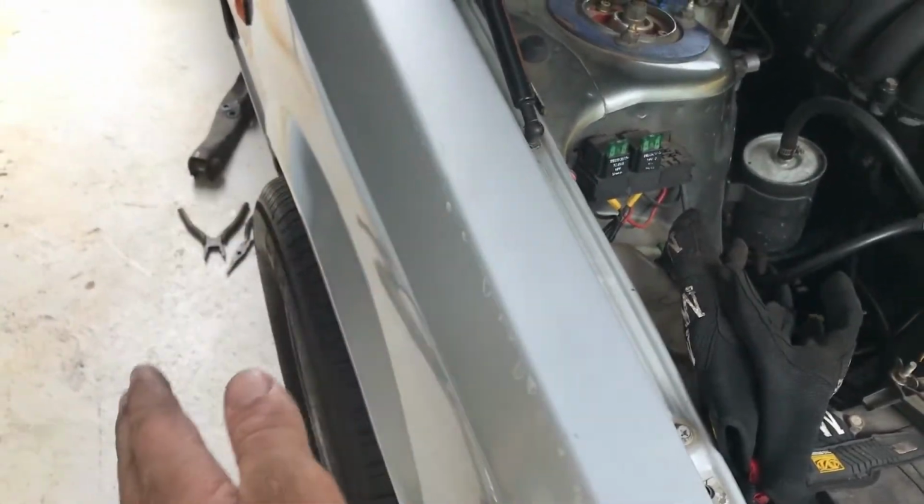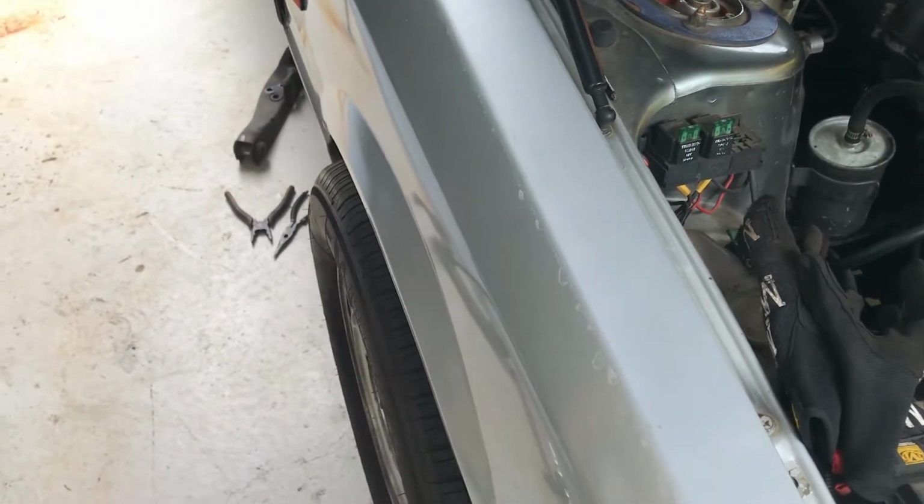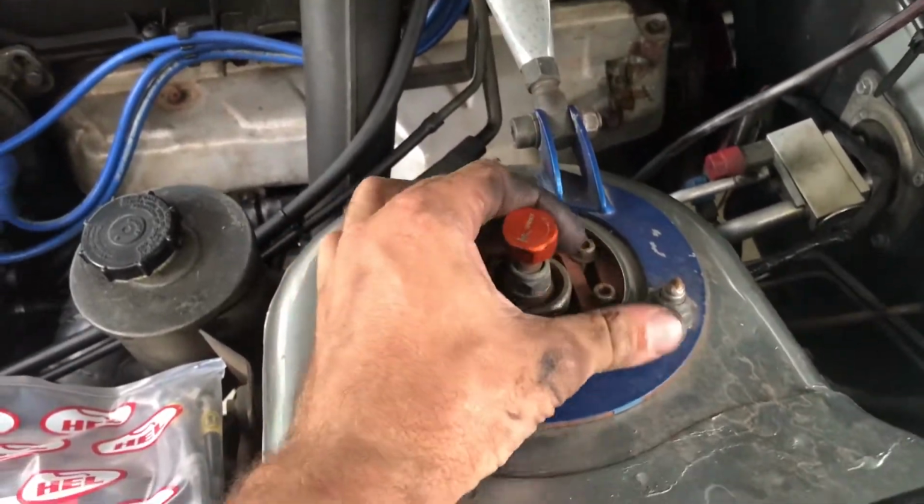It might roll in a little bit, and if it doesn't, we will adjust that knuckle in there and maybe look about some cambered bolts. But we're getting close. This is promising. This is the other camber adjustment. So just got to slide.